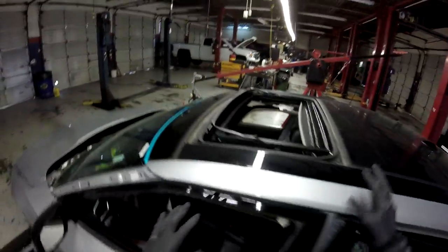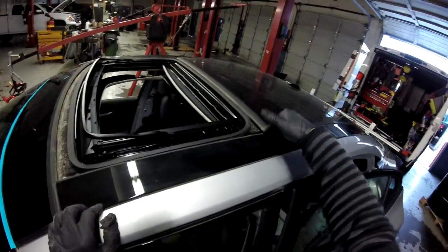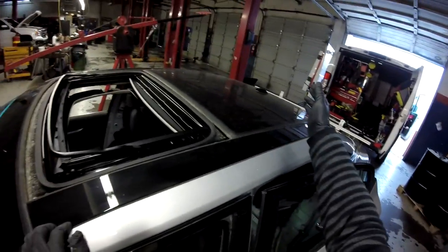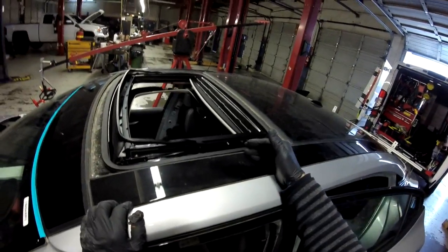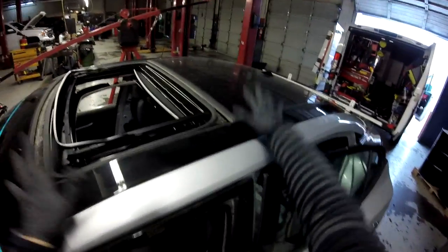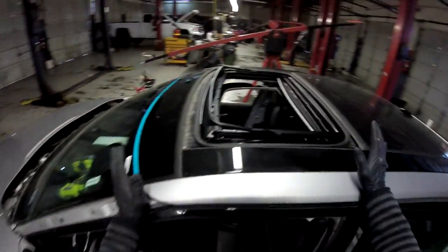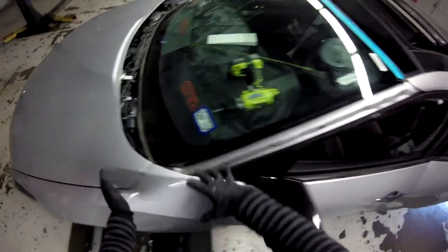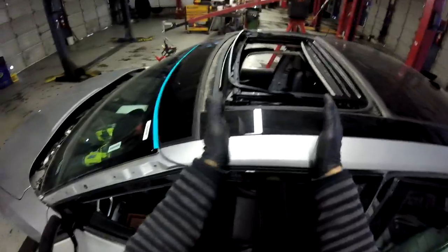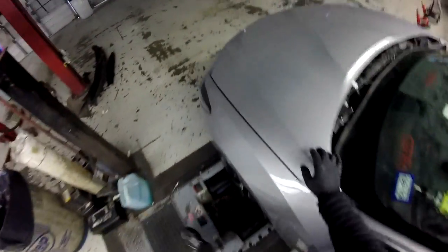Now remember, if you're working on this kind of roof glass and it's installed the wrong way, not with the temperature, the temperature is not a big deal, but the problem is the time you let the chemical set, like activators and primers. Because if this glass is not set the right way, when this car has an accident, all the energy is transferred to the car to absorb the energy in a wreck. This one is gonna come out or just pop, and all the car is gonna be smashed. So just be careful when you're working on this one.